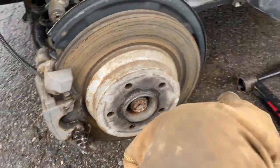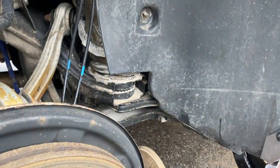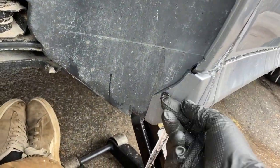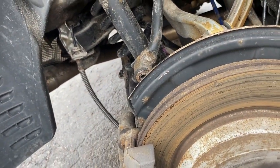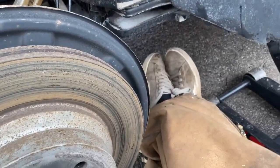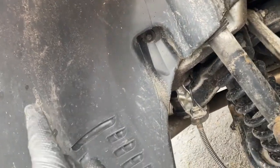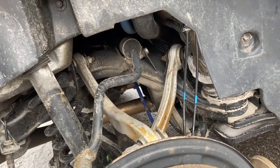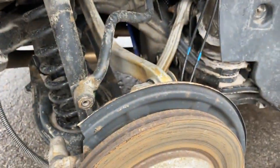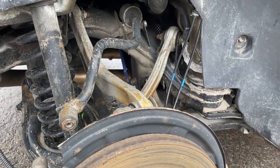Back to where we left off — of course it's freezing rain today and I'm doing this anyway. Wheel is off. There are three little plastic pull pins — use a flathead screwdriver to pull out the middle on each one. This is the right rear wheel speed sensor area. There are also 10-millimeter plastic nuts to remove — I count five of them. Pull those out and then we'll pull the wheel liner out to access the wheel speed sensor wire.